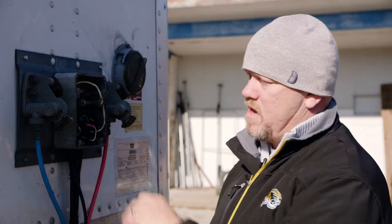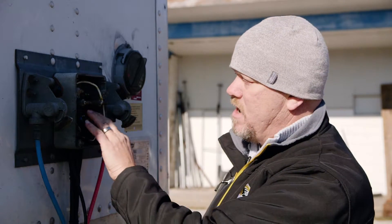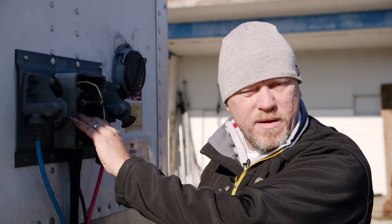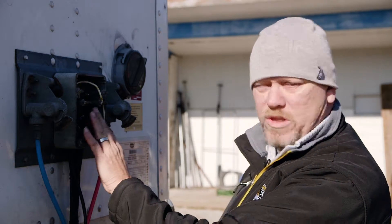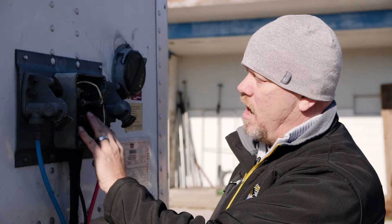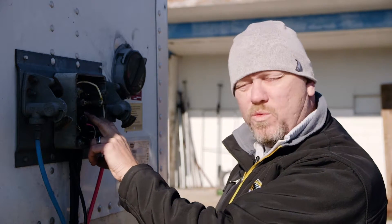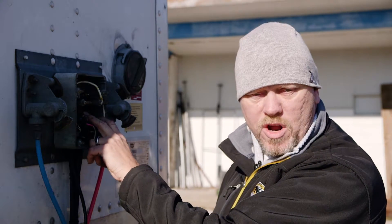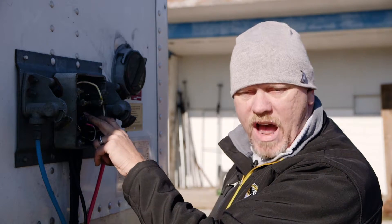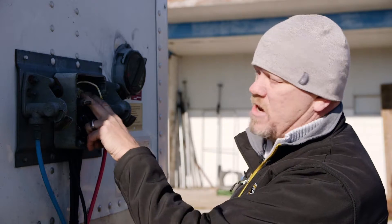One thing to note: the voltage on here typically on most systems will run between 11 to 14 volts, and can run about as high as 20 volts. You can test these with a voltage meter. Check your manufacturer's requirements for what's registered on the trailer. You want constant power — make sure you don't put it on the brake lights or your running lights, because those would actually have to be turned on to work. It needs to be a constant power source, something that's going to have constant power when it's hooked to the truck. And make sure you've got a good negative.